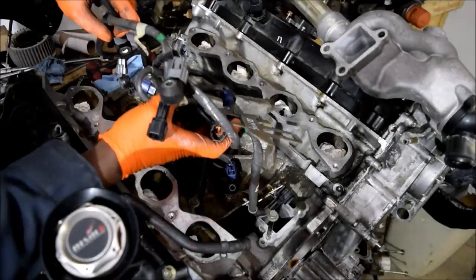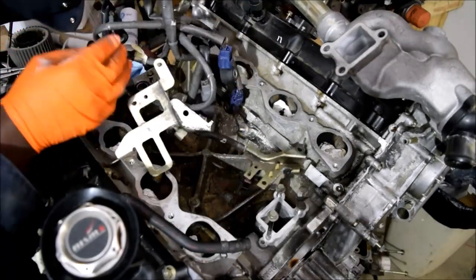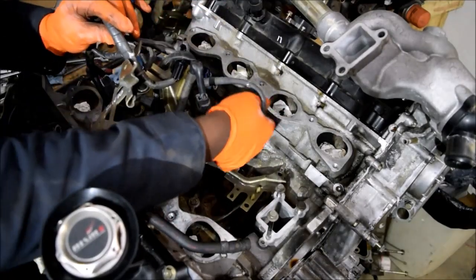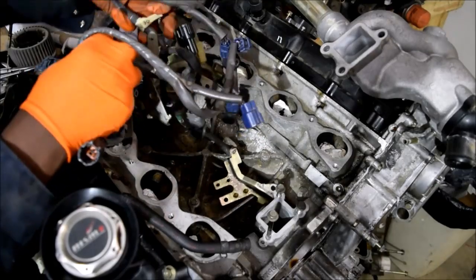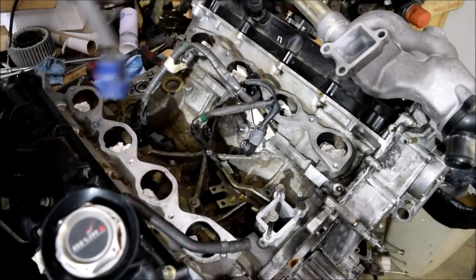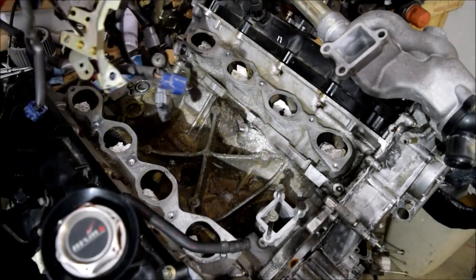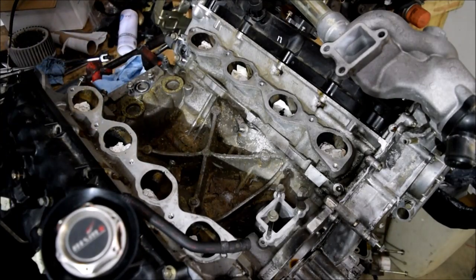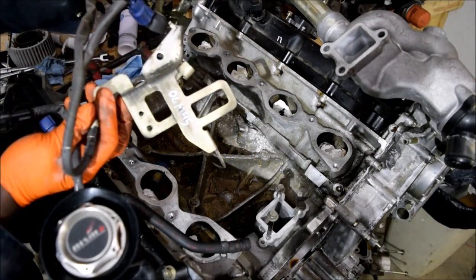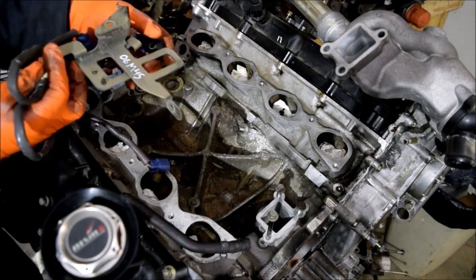I have a nest of them. If you have an 06 M45 and also the JDM, or if you're doing this as part of the JDM job, or you have an 03 M45, or the Q45 series — the way you can remember what sensors go where is: I labeled some of them. The blue plugs go to the 06 M45, and the gray plugs are the JDM ones — the ones from Japan — and also the ones from the 03 M45 and the Infiniti Q45. I like these knock sensors a little more; they read a narrower band.